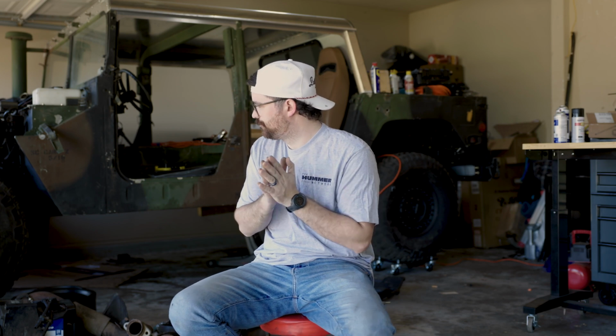I appreciate your time. So what is next as we wrap up this video? A lot. I still am not getting power to the starter, so I need to work on that. Fuel tank straps, I need to get, the drive shaft is kind of wedged in there. Those are from Anvil Motorsports. That'll probably be the next video, but I need to get that so I can move the tank down, put the blocks in, put the new straps in, new hardware. Really want to get power to the starter and make sure that that's all situated. I've got another starter if it is the starter.